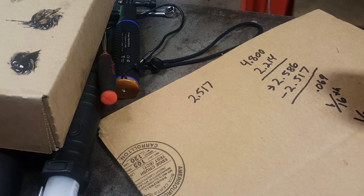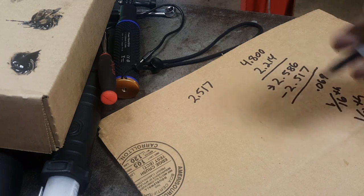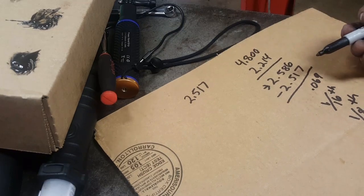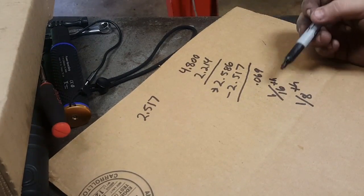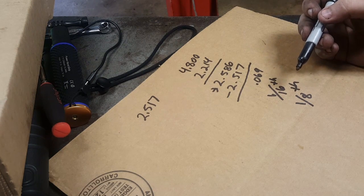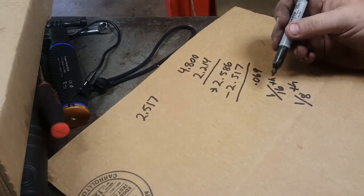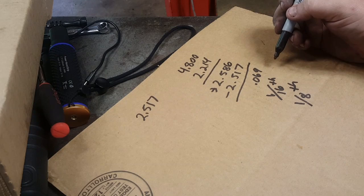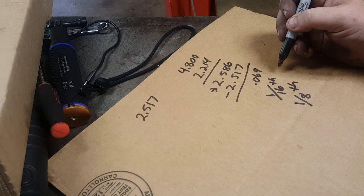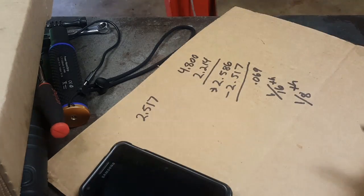And you want no more than an eighth gap, and you want some gap — that way the clutch can break in. Because as the clutch breaks in, the fingers are going to move out, and if you don't have any clearance at all it'll move out and ride that release bearing the whole entire time. So yeah, I got a sixteenth — you want no more than an eighth because you want some room. Tick Performance makes shims that you can get to space this thing out, spaces out the actual release bearing to move it out. Most of these LS6 or LS7 release bearings — the C6 release bearing one I'm using now with the green cover — don't need any shim at all. That's it. If you have any questions hit the comment button below, as always hit the subscribe button, see you next time.